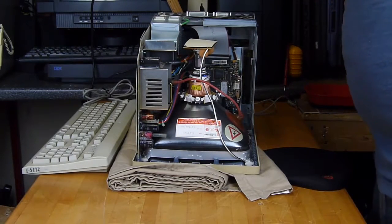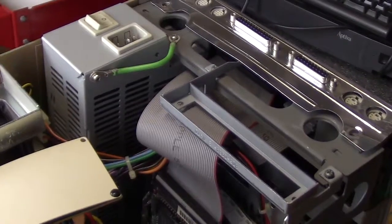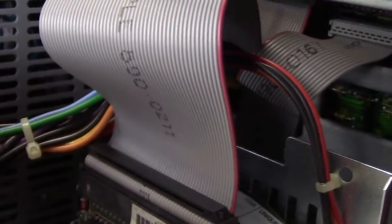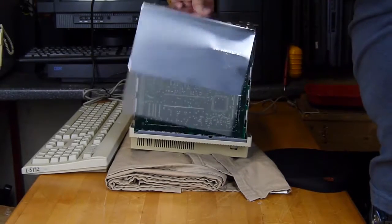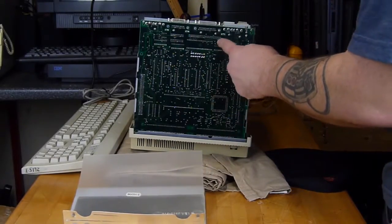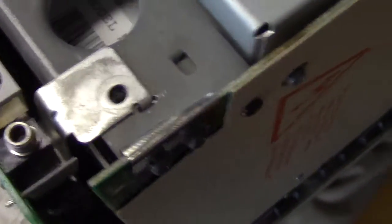Be very careful taking the bits out and don't drop them — luckily we were able to get them off the floor. As far as the battery goes, the battery is roughly on the main board under here. To get there we have to take off these ribbon connectors and slide the board out from the back. As always, be careful of high-voltage parts. This piece comes off here and the battery is right around on the other side. The motherboard is held on by these same clamps held on with the screw at the bottom. Let's go ahead and get those ribbon connectors off.